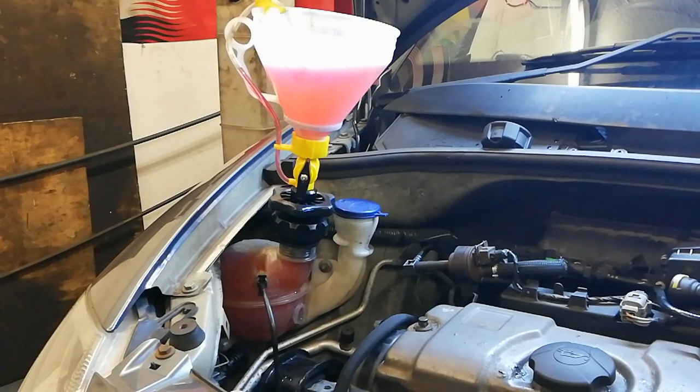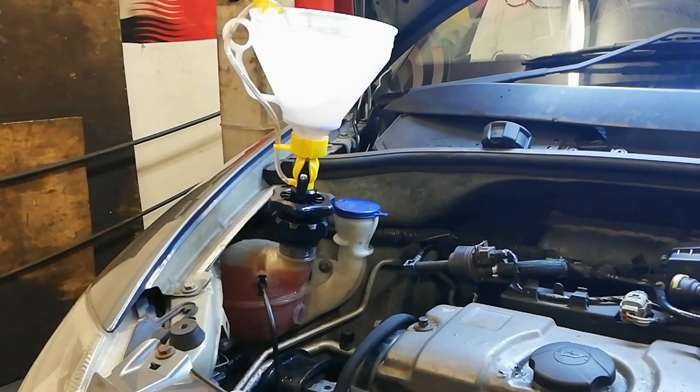The engine is stopped and as it cools down the level will drop way down. After a few seconds it's already starting to drop and will fall back down into the bottle. The temperature went to about 80-odd degrees with the cooling system open to atmosphere. The idea is to help evacuate all the air. It's now well down into the coolant bottle.